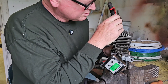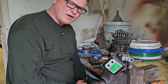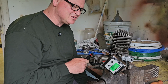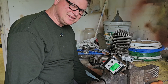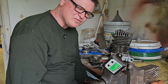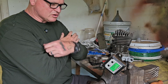The transfer — 120. 120! No wonder this thing ran so damn good. If I was porting it, that would be the numbers that I would pick. 102 on the exhaust, 79 on the intake — that's perfect — then 120 on the transfers. Holy Jesus, that's really good numbers. No wonder it ran so damn good once I unclogged it.